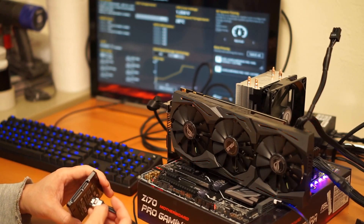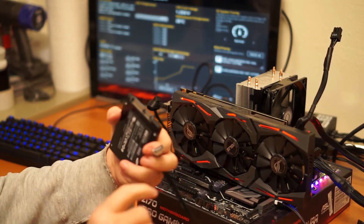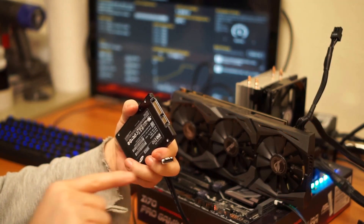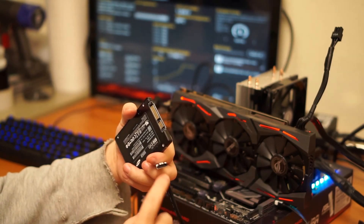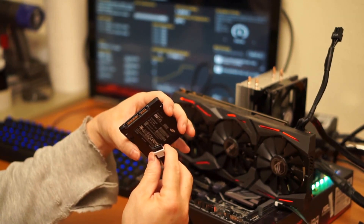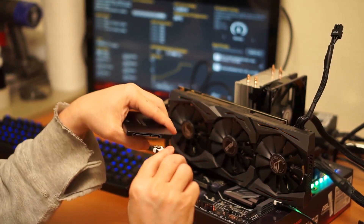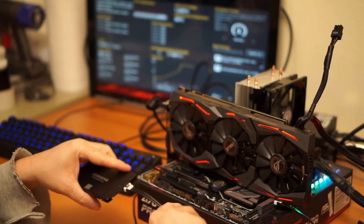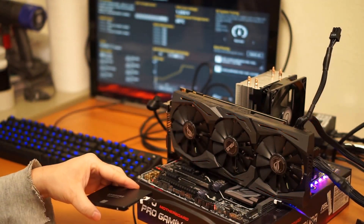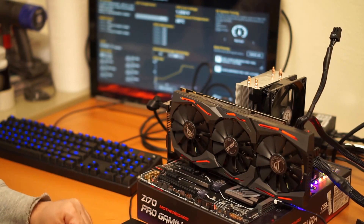This connects — if you look at the end of the SATA connector, it has a slot that way, but then at one end there's a little turn to it to make an L-shaped slot. You have to match it up with here on the drive. SATA is okay to plug in while everything's on, so that's why I'm not concerned, especially since that's the data cable and it's not even turned on yet.